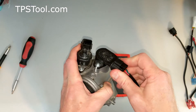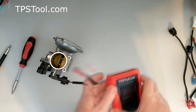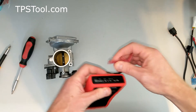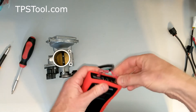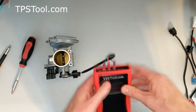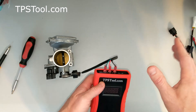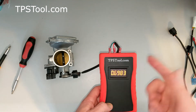We're going to go ahead and just plug this in — snaps right on. Now with a lot of the Polaris motors, their throttle position sensor is wired a little different. What you're going to do over here is put the ground — the green — into ground, red into feedback, and black into 5V. Now if you plug this in and you get a value that you're really not expecting, you've probably got the wires in the wrong position. You didn't hurt anything, don't worry. Move them around, send me an email, or check out our website.